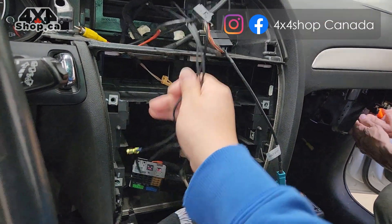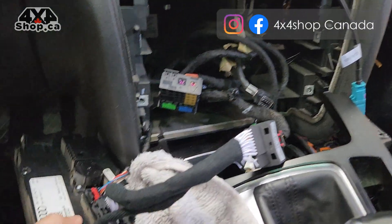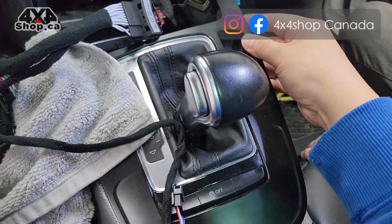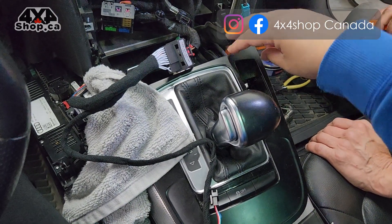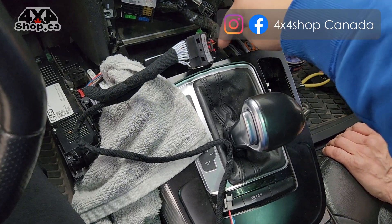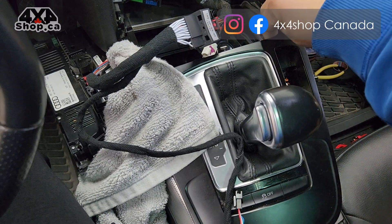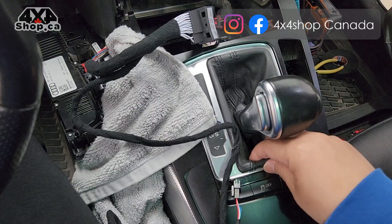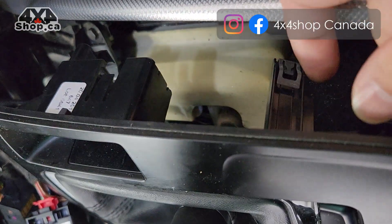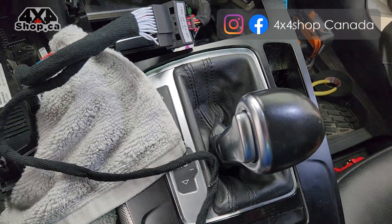Moving to the bottom, you'll need to remove the factory climate control panel and the radio. After you have those removed, lift up the center console trim panel. Use your finger to lift up from the side, behind the factory storage box near the cigarette lighter area, then from the side and lift up. Once you have both sides lifted, put your finger in to help release the bottom. All the clips are metal clips and quite strong, so gently lift up slowly.